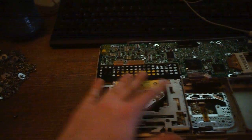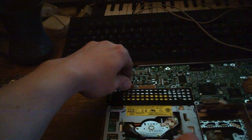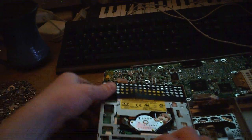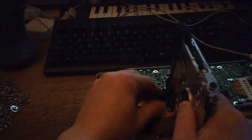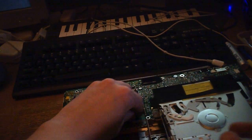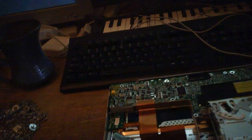The PRAM battery is underneath the optical drive. This is the optical drive. This is the cable for the optical drive — you just pop that up. And then from the left side, you just kind of pull the thing up. Now there's a bunch of tape, this kind of tapey stuff, on the other side and it kind of sticks, so you just kind of have to rip it apart like that. Sometimes the little rubber rings around the posts on the drive will come off. Now this is open — you want to make sure that these connectors stay down, because sometimes when you pull this out it pulls everything up. Here you have it — this is the PRAM battery. Any time you see this kind of odd glob thing, that's the PRAM battery with a cable and then a connector.